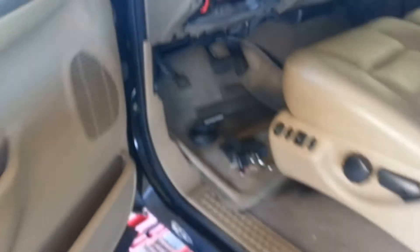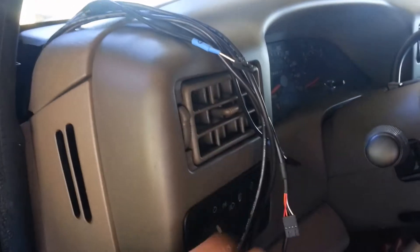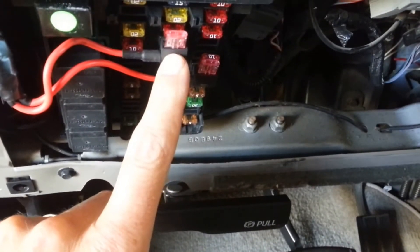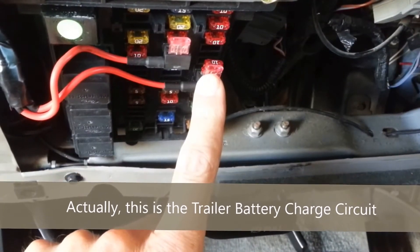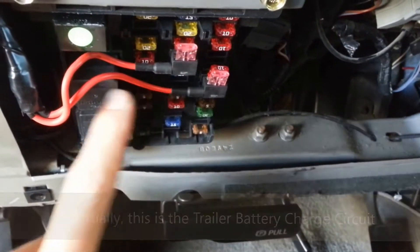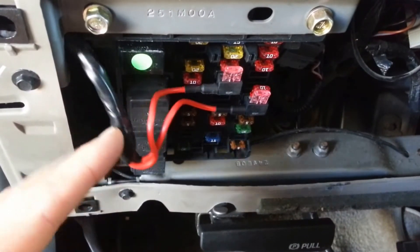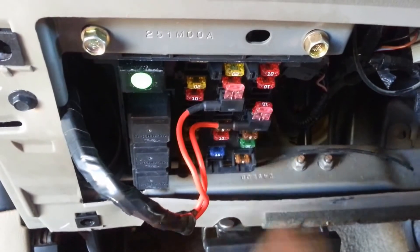What I've got right now is all the wires coming up through, which I routed under the dash. For power, if you have an F-250, I got the constant out of the dome light — basically a 5-amp — and I've got the switched out of the instrument cluster. I added add-a-circuit fuses and bound them all together, so you get the constant source and switch source all taped up.